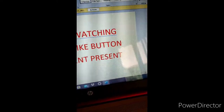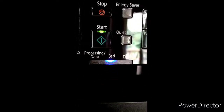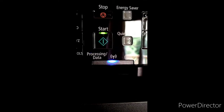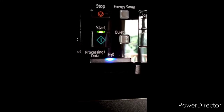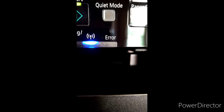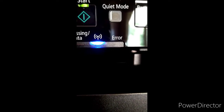See if it's going to go through or if we're going to get an error message. I'm looking for this data processing light to start flashing — that will let you know that your printer and your computer are actively talking. The blue light is just to let you know that the network is established, internet-wise. And of course the error light is if something is wrong, like when I didn't have the toner tray closed all the way and it flashed red.